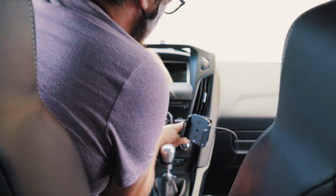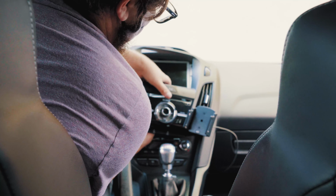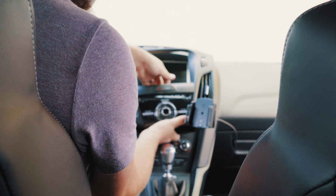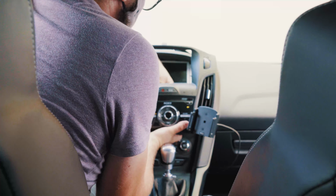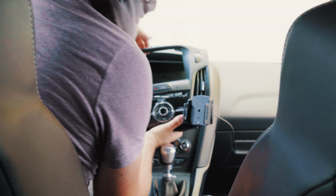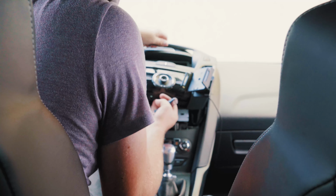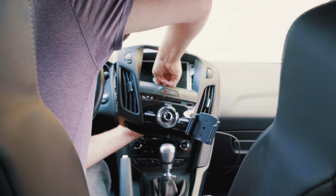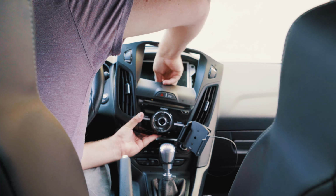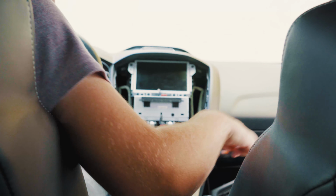There are two connectors on the back side here. One is on the bottom, right behind this volume knob, and we're going to pinch from the top. Then we have our hazard switch connector on the back here as well, and we're just going to pinch on that. Sometimes it's hard to grab it, so I would recommend getting your Torx screwdriver behind there and pushing in the connector that way. That will help wiggle it out. Sometimes you need to push the connector in more to get it out. All right, that leaves you with your Sync 2 display right here.